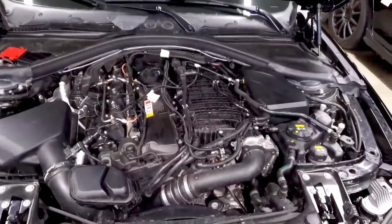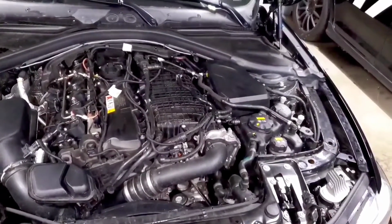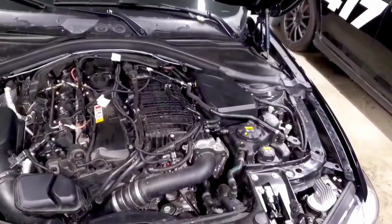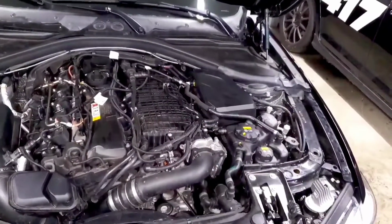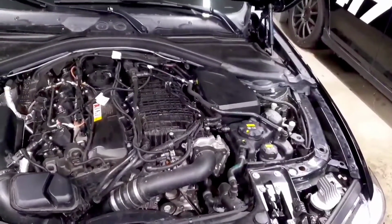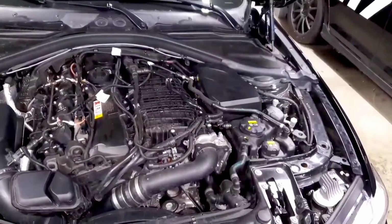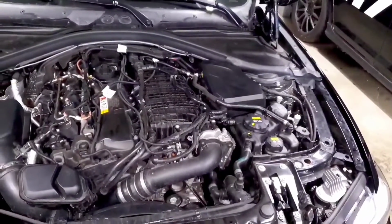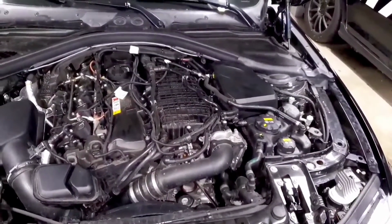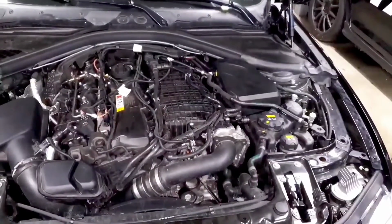Down low, sometimes it takes a little bit of time for the turbo to spool, so your target might say 15 psi, but it takes a little bit for the turbo to get up to that psi. That's completely normal. And then when you go to the top end, especially on a higher power tune, your turbo might fall out of boost, and that just means that it can't hold that much boost pressure up top. So again, that's normal. You want to be able to just see that throughout the rev range it's following boost, the boost curve is smooth, and that it's not doing anything wonky or unexpected.